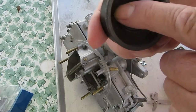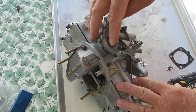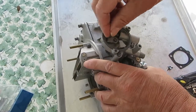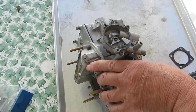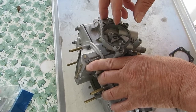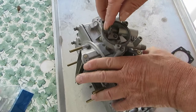This little end piece fits right into this groove. Right in here is your choke piston — if this doesn't move real free, remove the clean-out plug here and clean it out really good. You can try spraying in some silicone spray lubricant. The piston on these is usually brass, so take that out being very careful — there's a little pin on there that'll break, and this arm here will break easily too. If you do take it out, brush out the hole, buff out your brass piston, and you're good to go. It just needs to work freely like that.